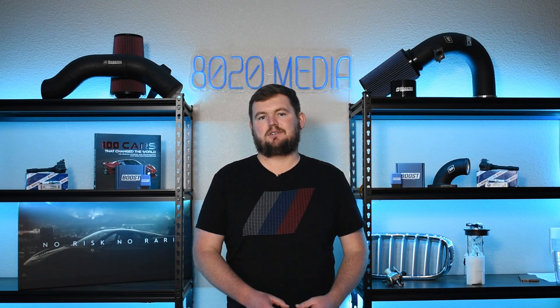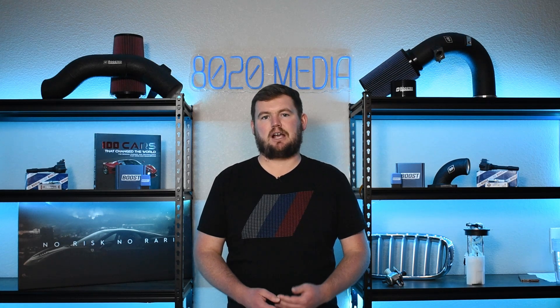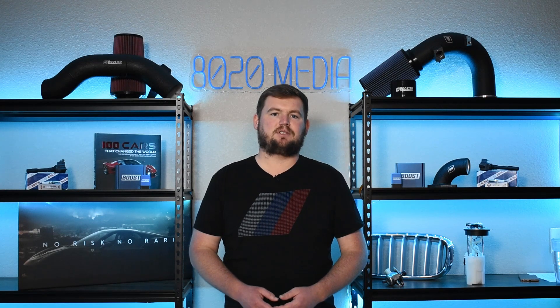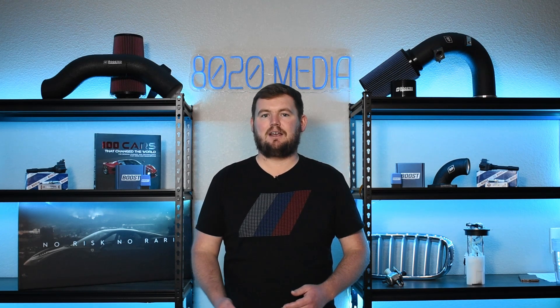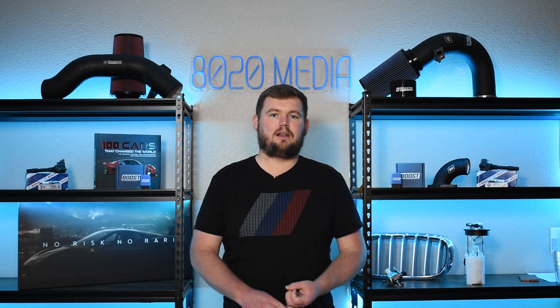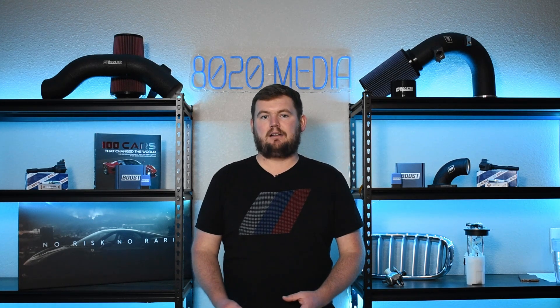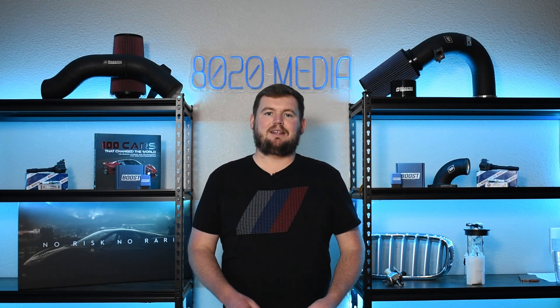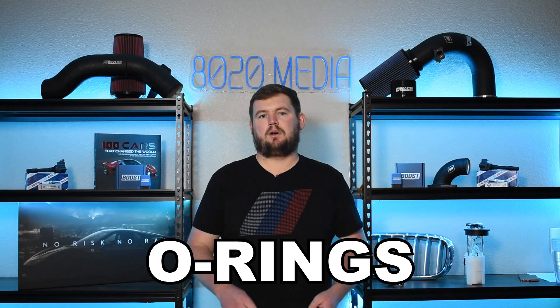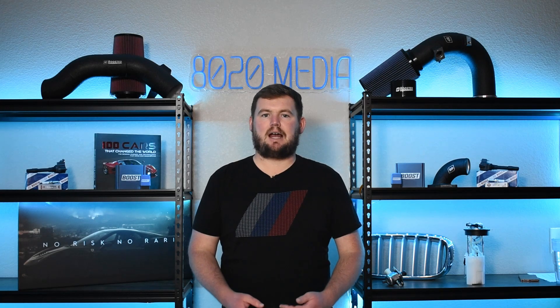Nowadays, with the M60 being a roughly 30-year-old engine, there are a lot of components that will likely need some additional repair, replacement, preventative maintenance, and extra TLC. That's especially true if you're picking up an M60 from a junkyard or somewhere it's been sitting or hasn't been maintained well. All sorts of different plastic or rubber-like components simply degrade with age — even outside of mileage, age alone can take a toll. Things like coolant hoses, gaskets, and O-ring seals on these older engines are common problems that should ideally be replaced.